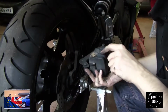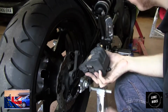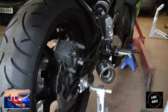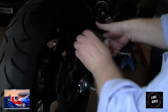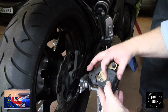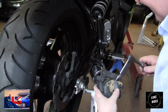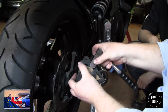Different design, this one. So we have the pin slide. It's all learning, guys. What we've got is the same brake pads, but in a different position. So there's the R clip, the pin here, a set of three. I'm looking at the large one being away from the piston, the small ones with the piston. I'm just gently pushing the caliper back in.